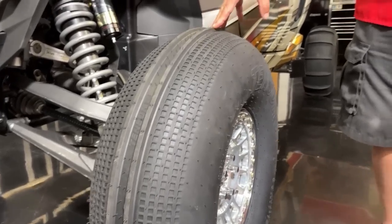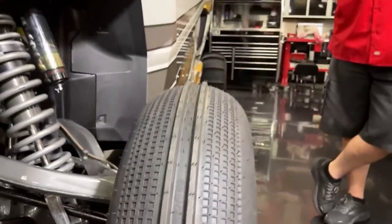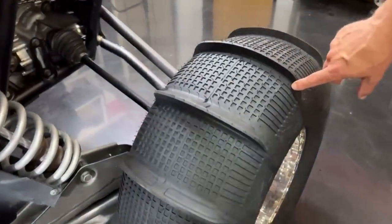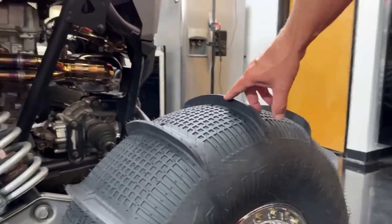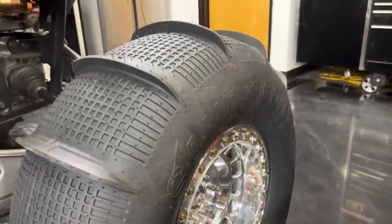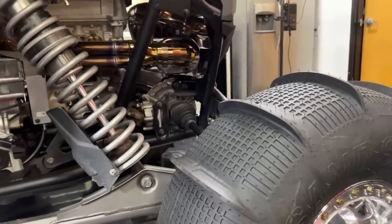If your driving style requires more front-end bite in a corner — especially when you turn the wheel and don't want to have a push — then this Tensor/Method combination might be a good choice for you. In the rear, these also have Velocity Grid tech giving you traction between paddles, and they have a molded paddle into the carcass. Unlike a buffed tire with a glued paddle, these are molded in. Unlike Sand Tires Unlimited, these don't come in multiple paddle heights — this has been designed to go with horsepower levels between 185 and 240 horsepower and a UTV between 1,600 and 2,200 pounds. If you wanted to throw 500 horsepower in your UTV, you might need a bigger paddle.